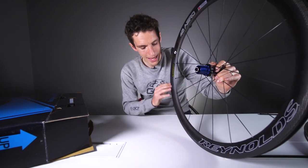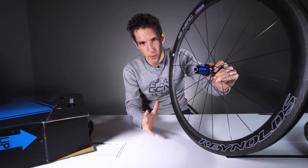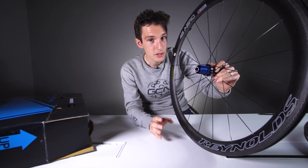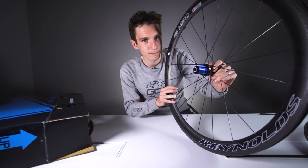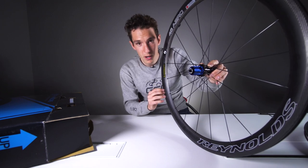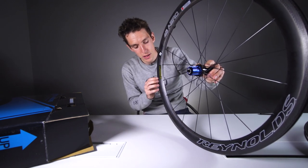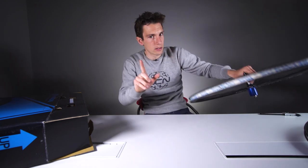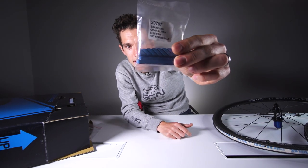One last thing we should talk about on the rim is the braking surface. It doesn't sound sexy, and it's not, but it is super important. When you brake, you get heat build-up, and carbon is naturally not a very good conductor. So in order to ride down alpine descents and crucially stop at the bottom, you need to do some very clever things to carbon rims. Reynolds have developed what they've called a cryogenic glass transition — basically their own proprietary laminates in the rim that draw heat away from the surface to be dissipated, just like you'd see on a metal rim. They've also used a super high grade of resin for heat resistance — lower grade ones would actually melt. And they also have their own proprietary brake pads in the box.